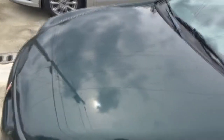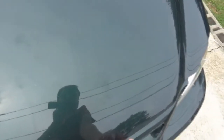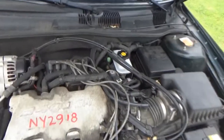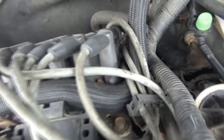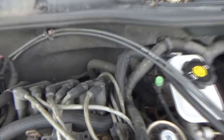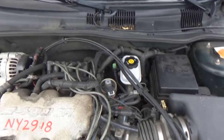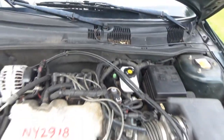Oh, there was one more wire that I had to chase down, and this was an absolute good one. They had a purple wire running under the steering column, through the floor, like the firewall. And it tied into, you can't see it, but it tied into one of the ignition control module wires for the tach. So it was a tachometer input. They did the same thing, they just kind of tied into it. So I chopped it off, put some tape around it. That should be good to go.